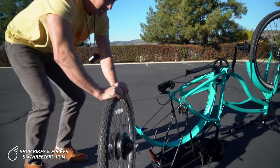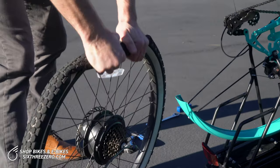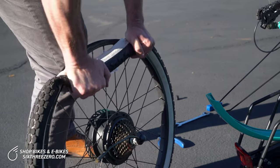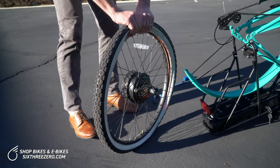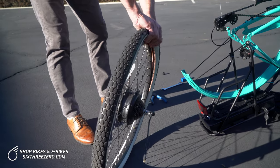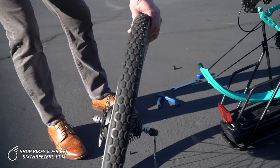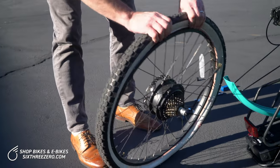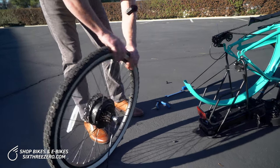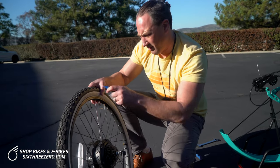You're also going to need a pump for this. I don't need tire levers for this one — I can just pop it off like that with my hands and go around. But I'll also show you how to use tire levers properly. You can insert one and hook it on the spoke, then grab the little open part and move it down. Often two levers is enough, but we'll go with three. You may not need tire levers — I'm just showing you how to do it.